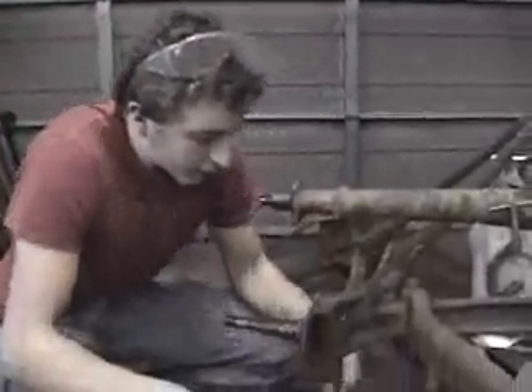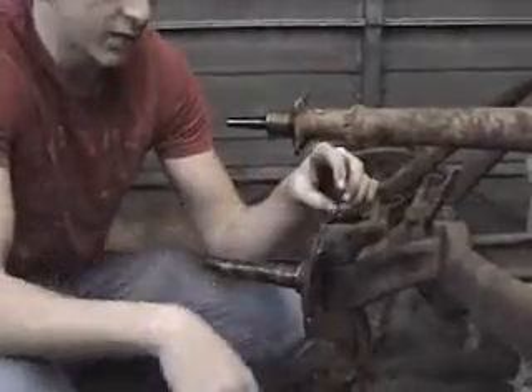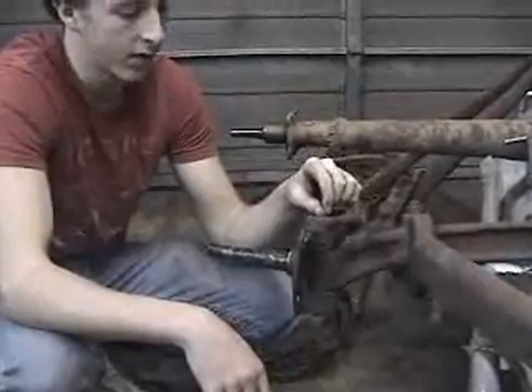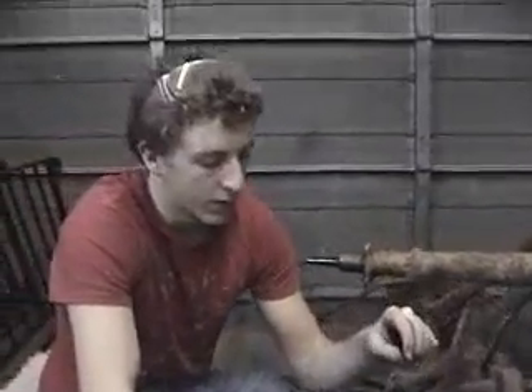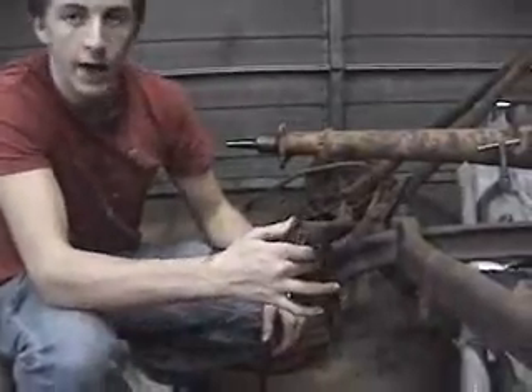Now what we've got to do is take out the kingpin — it's this part right here. That's where it's the point of rotation where the wheel turns. That's where your turning is done, and it just locks everything in. It's kind of like modern-day ball joints on a car. Even some trucks have it today, like some Fords. It's old and outdated — now they've got that ball joint kind of setup. We already took out the lock, which holds the kingpin in place to make sure it doesn't bounce out.